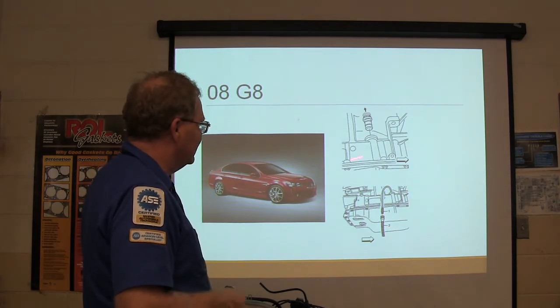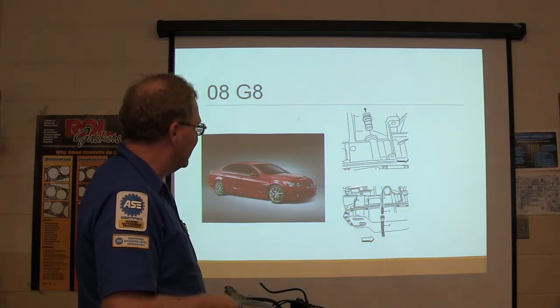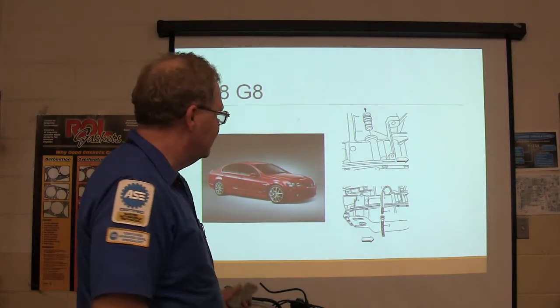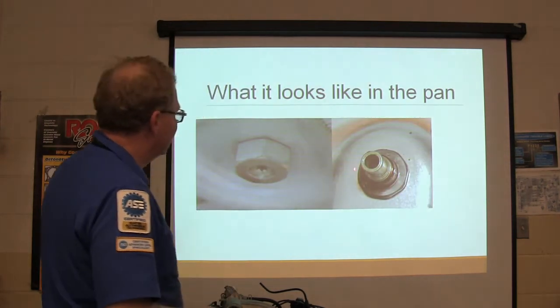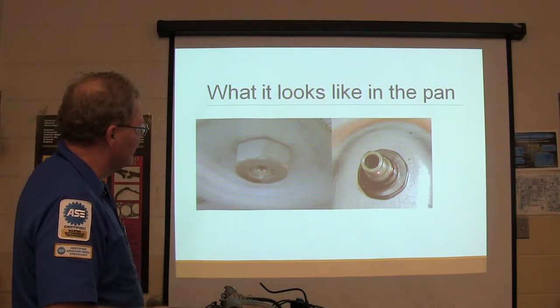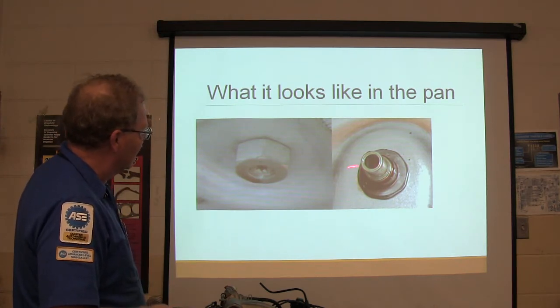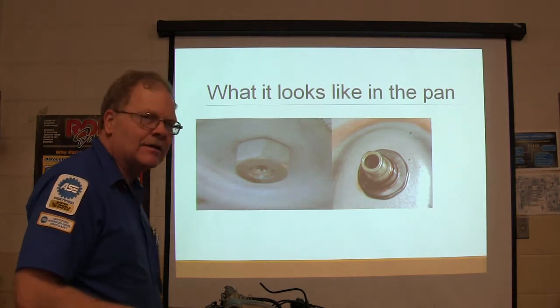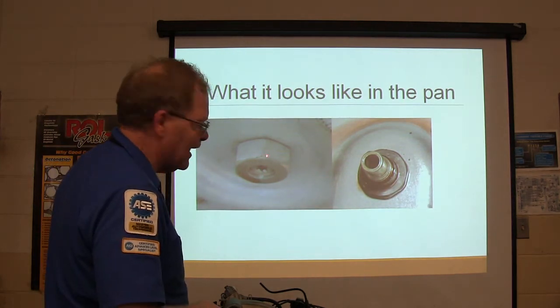So anyway, this is just a quick look at that. Basically that little standpipe thing down there is going to be the same deal, I believe. This is what the standpipe looks like on this Ford. It goes up in here, and you screw that middle part out and leave this in there. If you want to drain the transmission, you screw this whole thing out.